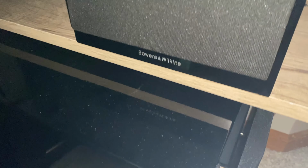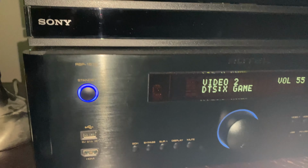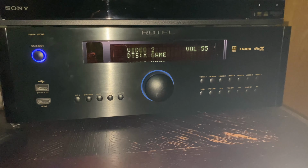On top of that, the other subwoofer I ran with the Valentine is a Niles compact 8-inch, and I let the Valentine 8-inch handle all the LFE, and I'll let the Niles 8-inch handle all the low frequency, because the Niles 8-inch subwoofer bottoms out at a certain level, whereas the Valentine can handle everything. But when I pushed it with my separates amplifier, it just couldn't handle it. So that's why I had to swap it out with my 10-inch Rel T9X.